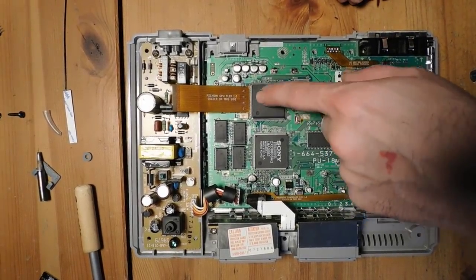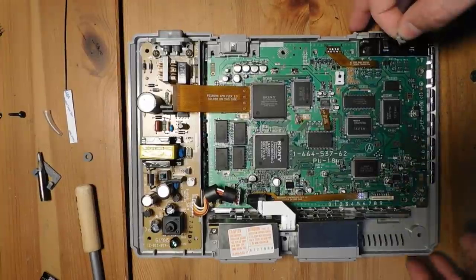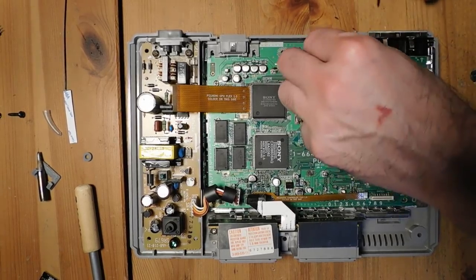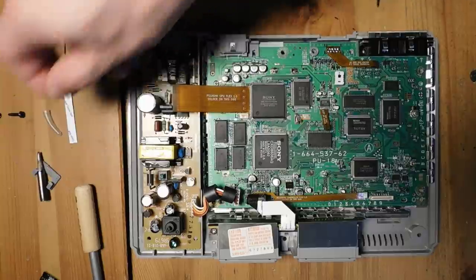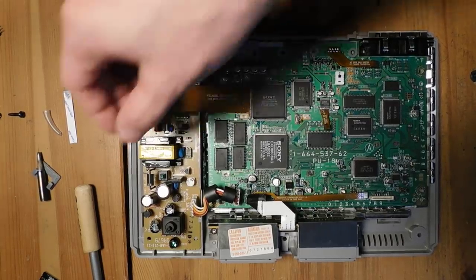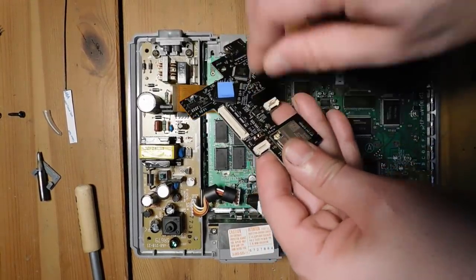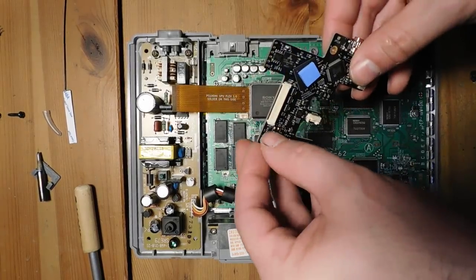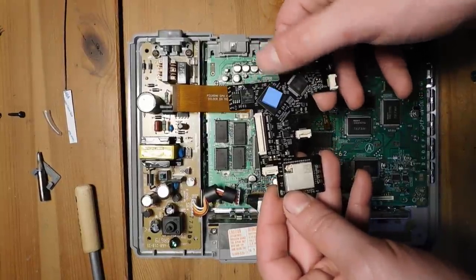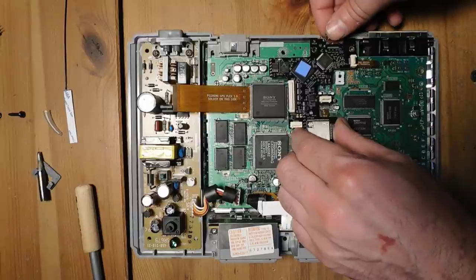I tested continuity and didn't find any problems. Now I'm putting everything back together. The motherboard goes back into the case, and we place the little washers provided with the kit where the HDMI port will go. Before placing the board, open up all the little cable flaps to make life easier. There's also a little thermal pad included in the packaging — it tends to fall off, so make sure you find it, as it transfers heat from the board to the RF shield.